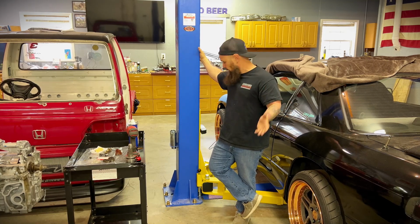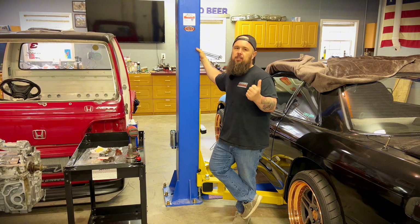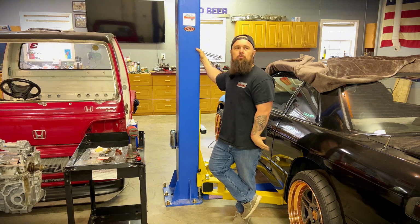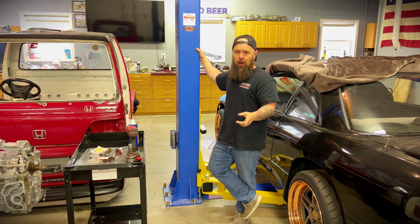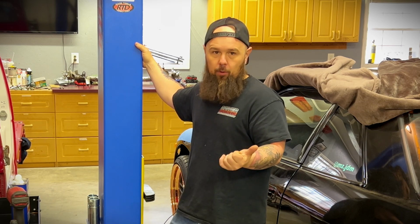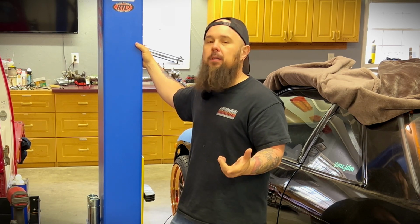And like I didn't have enough going on with the project vehicles that are just scattered about my little home shop, I was working on the Sylvia the other day. I was like, all right, I'm pretty close on this bad boy. I have an issue with the starter. It's not getting power, it's not getting ground. It's a pretty easy problem to solve with a voltmeter. Either it's not getting the 12 volts that it needs to kick over, or it's simply not getting grounded.